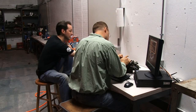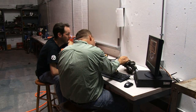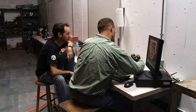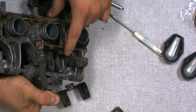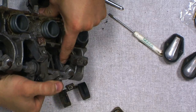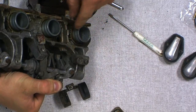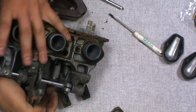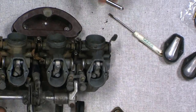If we just roll the idle screw here in, will that hold those up and out like that? Won't be long enough. Oh, okay. Just to show you what he's talking about, it's running the idle screw in as far as possible so that it will push this out, but we've only got another 1/2 inch, 3/4 of an inch of travel there, and we need to go out at least 1.5 inches, 2 inches. So we will have to find some way to prop this out.